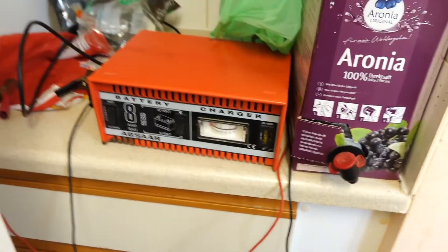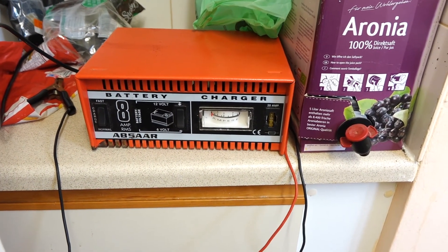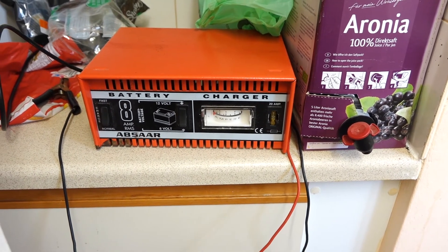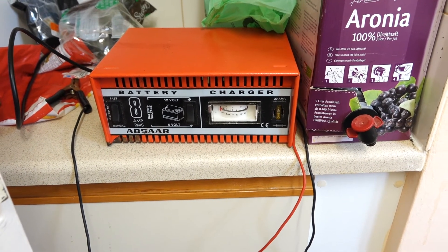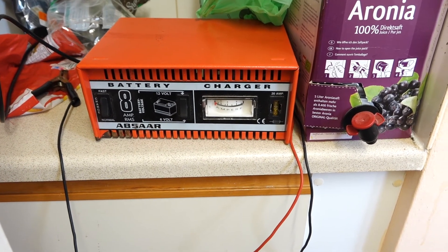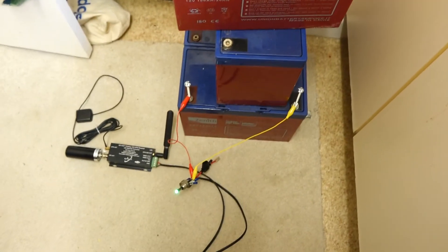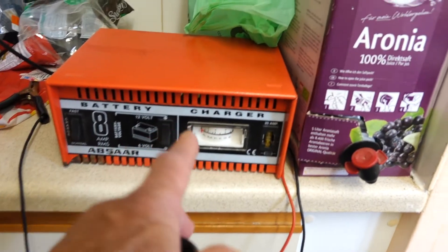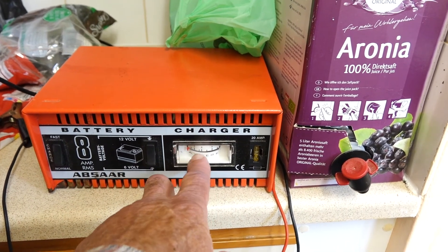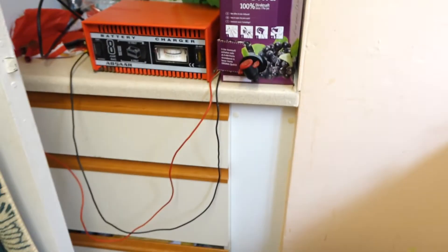I've been monitoring the batteries and learning quite a bit about chargers and charging. This is a traditional charger that will charge no matter what battery is connected. It's useful because if a battery is in bad condition or too low voltage, some automatic chargers won't switch on at all. You can monitor the condition of the battery by watching the ammeter — apparently when it drops to three amps, it's fully charged and you shouldn't charge it beyond that point.